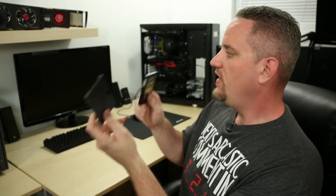I'm going to show you guys the way that I do it. This is the drive that came out of Skunkworks — the main SSD was an ADATA SX900 256GB drive, and I have the exact same drive in a 128GB format in the test rig behind me. It doesn't actually matter what kind of drives you have; it doesn't have to go from SSD to SSD. It can go from a hard drive to a solid-state drive and back. All it's going to do is take the data and clone it over to the new drive. I use a program called Acronis True Image, which comes bundled with the ADATA drives.